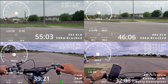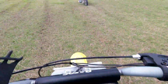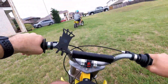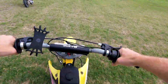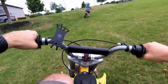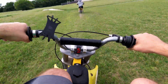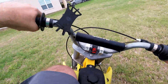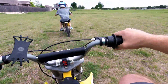Alright guys, as you can see there are tons of improvements that can be had with these little motorcycles with just a few small modifications. Some information I didn't include in the intro: I weigh about 200 pounds, and all of these bikes have the exact same gearing — what I changed out was controllers, motors, and different batteries at different voltages. I have another motorcycle I'm running right now that is stock controller, stock motor, stock voltage at 36 volts, but it's lithium, and I saw huge improvements with that for my daughter. So there are a bunch of different options you can do to have a lot of fun on these things. Thank you guys for watching — I hope this was informative. Let me know if there's anything else you want to see. I tried my best to do these recordings as I was building out these bikes to give you a good solid comparison and help you manage expectations. Alright, get off YouTube, go outside, get on your motorcycle, and have some fun. Take care guys.